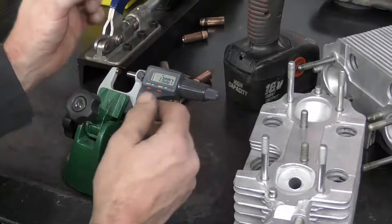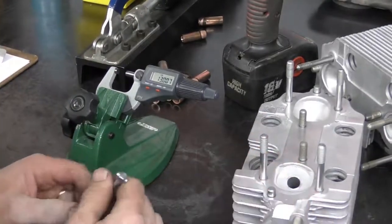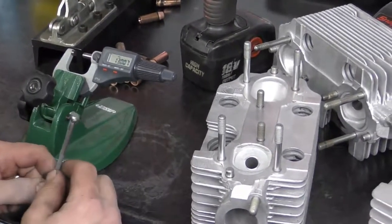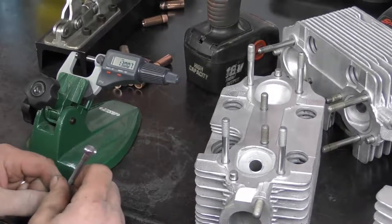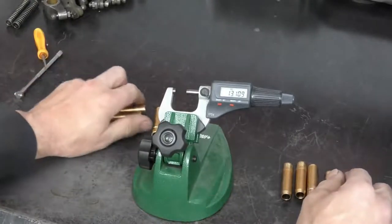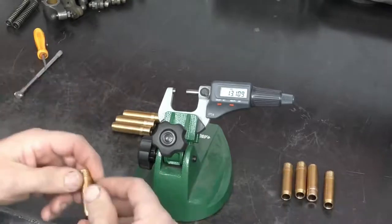13.007. Now, if any of the valve guide bores do not clean up with just a hone, then we'll have to run a ream down, in which case we'll have to go with a second oversize on the valve guide insert. We took a preliminary measurement of valve guides so that we could place an order, and now our valve guides have come in.